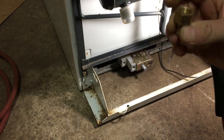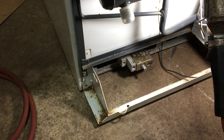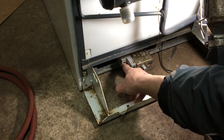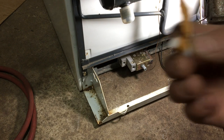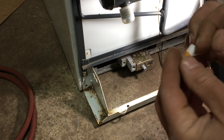Before putting it in, I'll blow out the valve for good measure to make sure there's no dirt in there. Right inside here is where the main gas line comes in, and it actually takes a filter. Looking in the manual, you can buy a filter from Danby, Consul, or Unique — but the manual also says you can use a cigarette filter. I peeled back the paper on one and I'm just going to cut it to fit inside here.